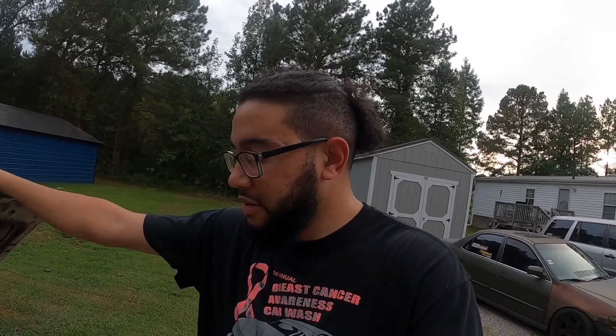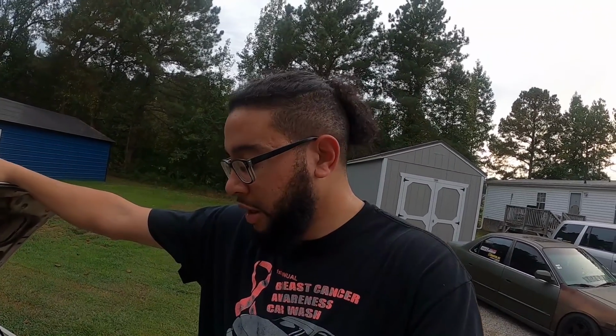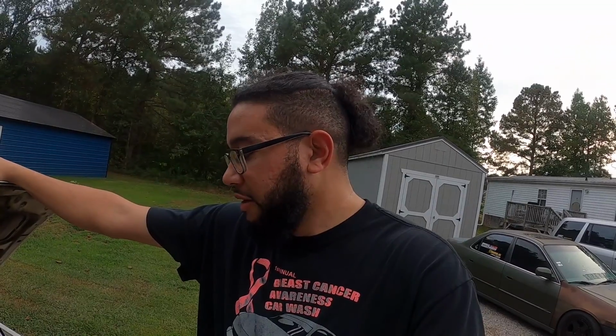Maybe we're thinking 14 pounds, and maybe even add a little bit more timing in it, because we're really conservative, guys. This thing has absolutely no timing added. So at the end of the day, we're hoping for around 320, 330 torque to the wheels, which I think is going to be a rocket ship in this car, and it should be really fun.